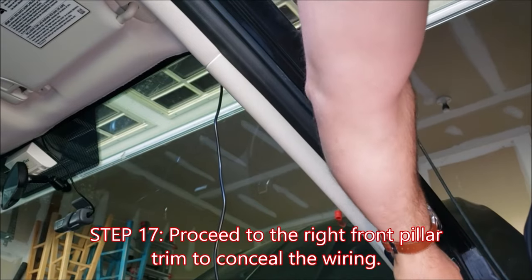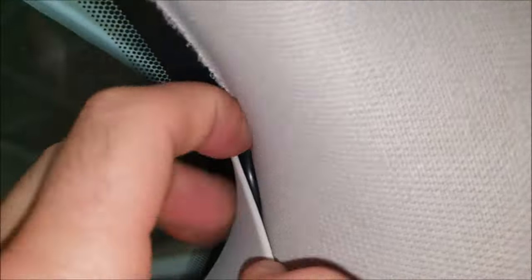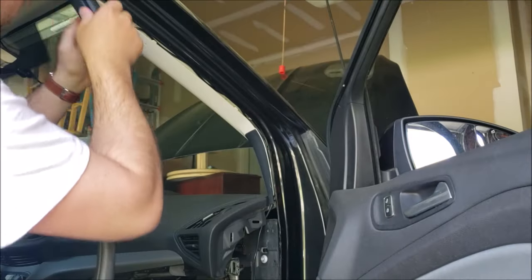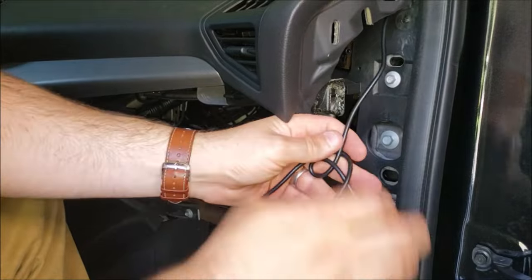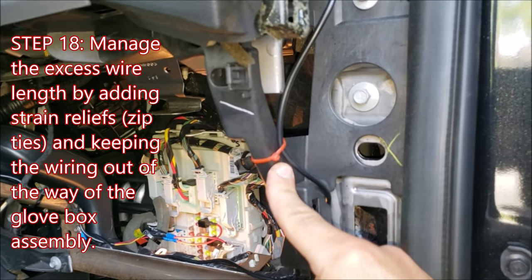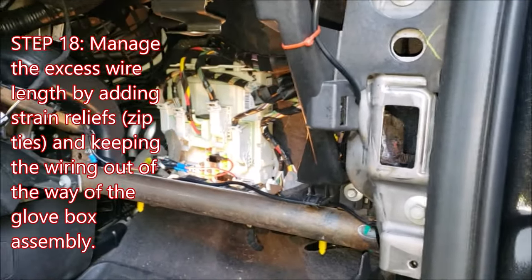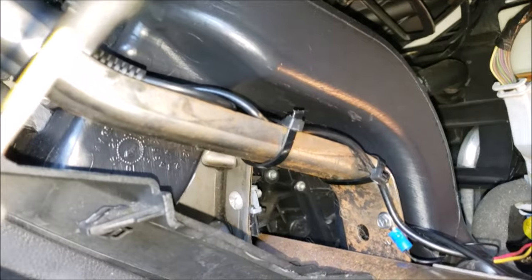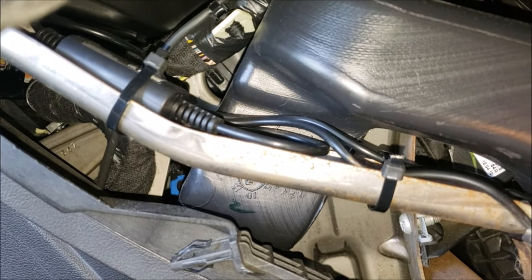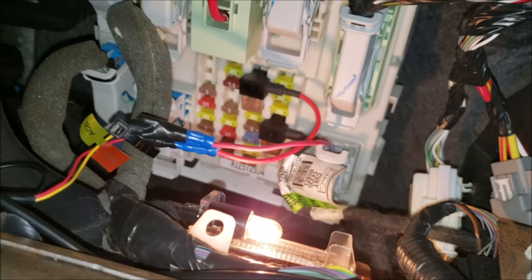I pulled the weather stripping away from the doorframe again to be able to pull the pillar cover away. It's better to tuck the wire behind the plastic here. Then we ran the wire down between that plastic trim, behind the weather stripping area, into the side of the glove box space. Now you're left with all the slack you need to manage without getting it caught when you put the glove box back in. Here we have a red zip tie that we used to secure the wire as strain relief, and we ran the wire down the side of the vehicle hugging it to the right end of the bar. We ran it along the bar, secured it to the same bracket as the ground, and bundled the excess gently on the backside of the bracket including the voltage regulator. Then we zip-tied the wires gently to the wire harness, keeping them away from the light bulb.